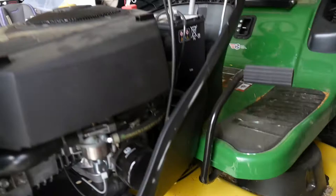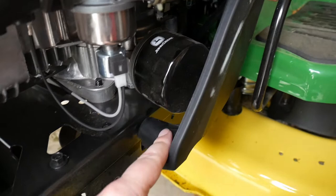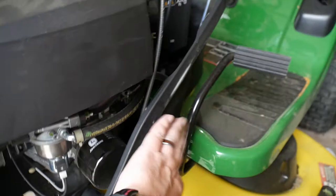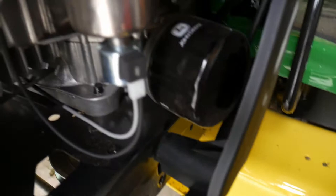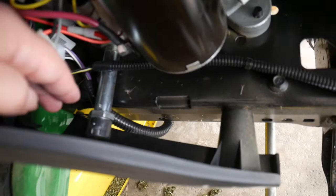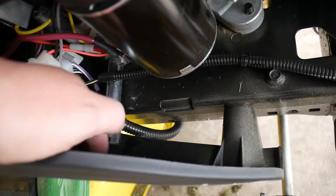On the other side you've got your carburetor, and down here is the oil filter. There's a bolt in there but that is your engine cowling, and it goes right up into all of that — it's not going to come off easily. There's not a lot of clearance in there, about a finger's worth, so we'll see how much of a pain that is to deal with.